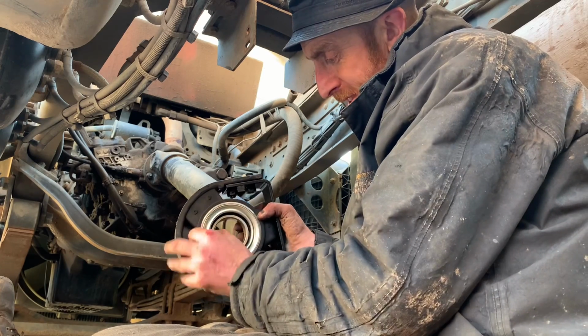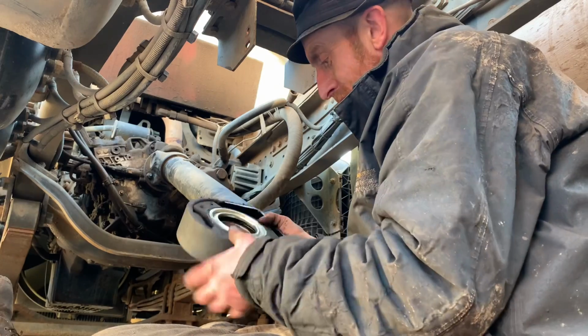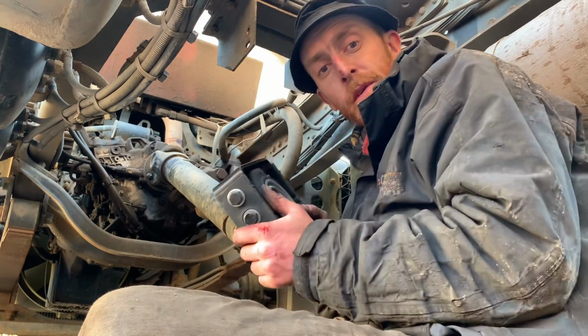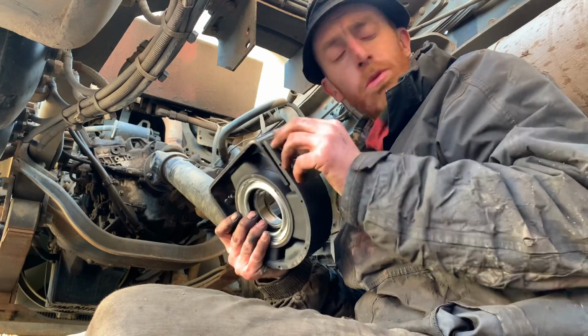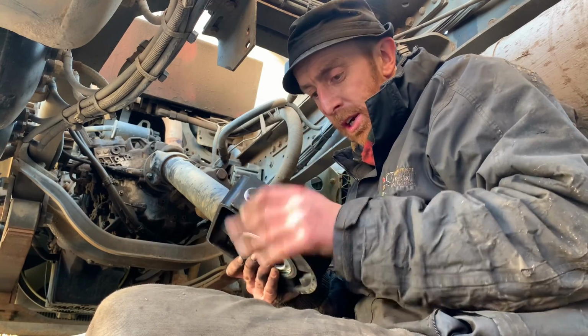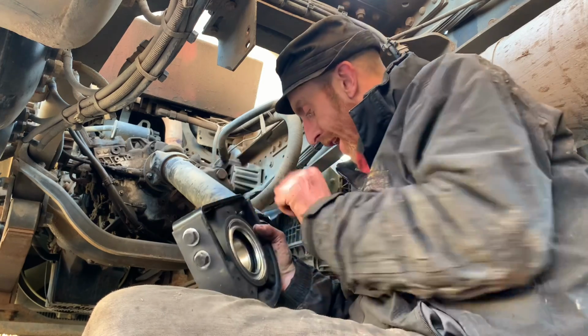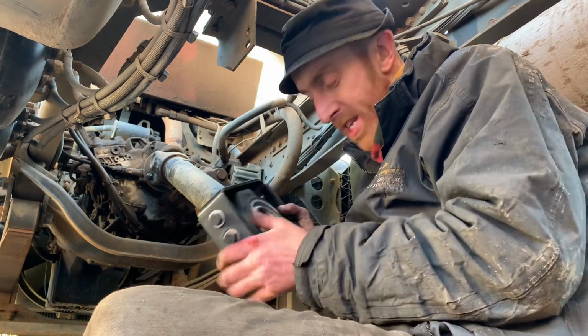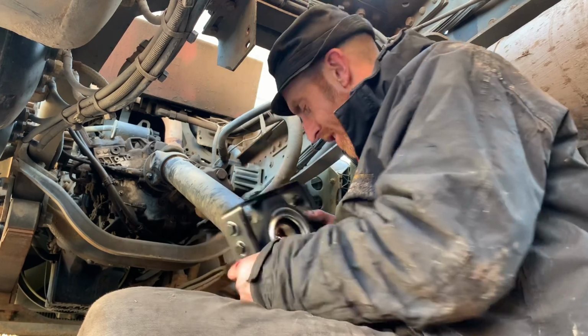That's just basically like a cover, so no dirt gets into the bearing. Right, then we fit the bearing on. I'm going to leave this, look, it comes with a new bracket and everything. Even comes with bolts, that's a rarity. But I'm going to leave that bolted for a minute and put this on there, slide it on. It might be a bit tight, so I might need to get a copper punch and just ease it on nicely.